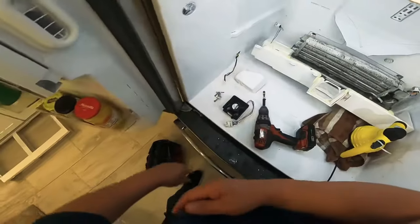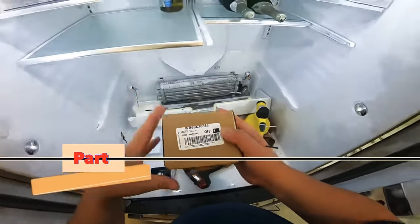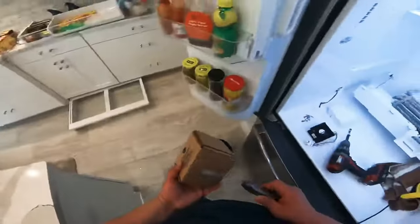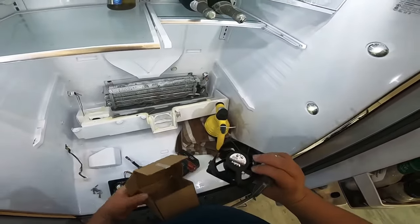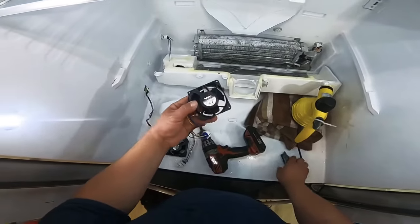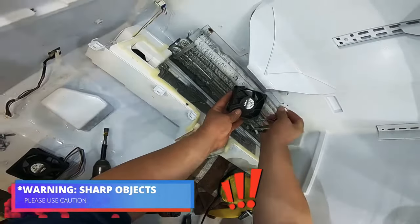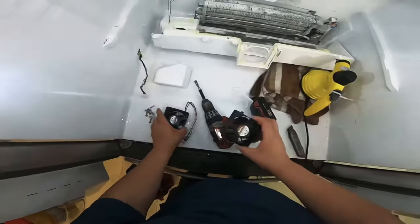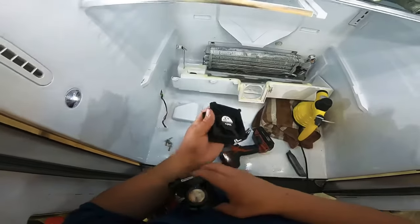Here is the old fan motor. The housing is a little different on this model — if yours has a different attachment, go to my channel and search for GE fan motor replacement on a French door refrigerator. I have two or three videos about replacing this fan motor. This is the first time I've seen this particular attachment — it appears to be a newer model. The new fan motor is working fine. Don't put your fingers on the blade; put your hand on the middle to stop it.